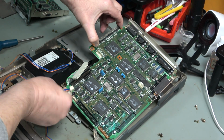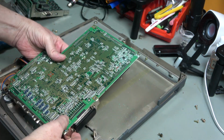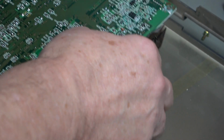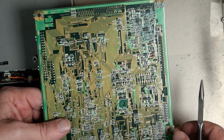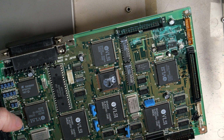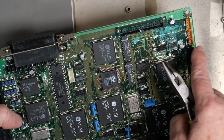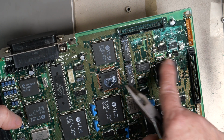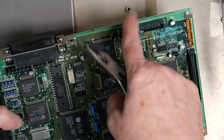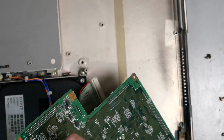And we should see the horrors of what lies beneath. So this is going to be the worst area because this is under the battery. So it's come through, I guess, maybe the vias, but certainly all around those surface mount components we can see corrosion. And green stuff on that side doesn't look so bad. It's mainly U144 and a little bit of U127. And those traces over there, fortunately most of that is blank. And this connector, we might have to take that connector off. God help us with this connector, it's 4 rows.